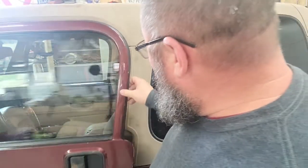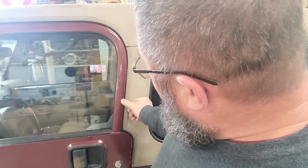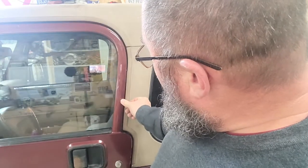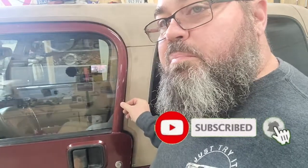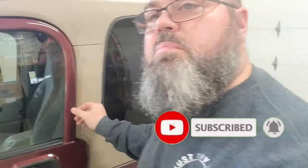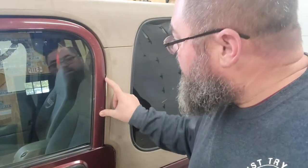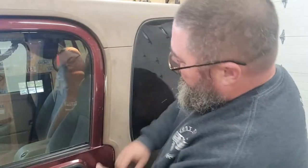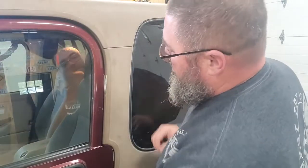Now hopefully, like I said right here before, it was pulling that seal. Look at that right there — slides right by it. If we didn't have every 16th of an inch or 32nd of an inch, that thing just barely makes that right there. You can see right here where the paint's missing — that's where it's dragging really bad. And when you closed it, like you've seen earlier, that seal was all pulled out right there. Now look at that — that's perfect.